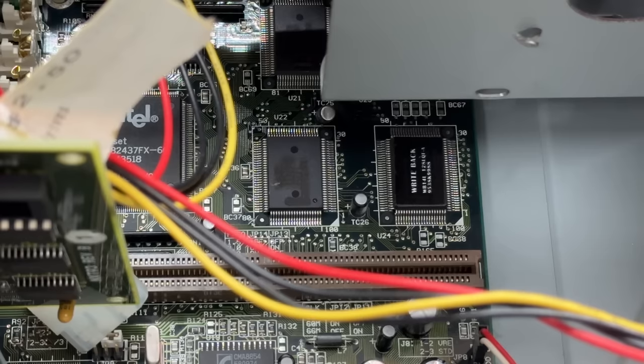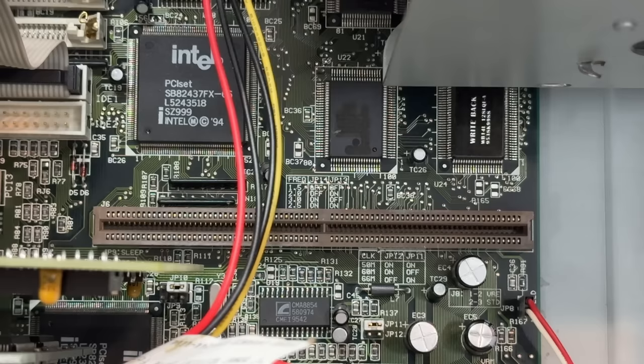I had a system just last week with one of these motherboards in it. They ship these motherboards with these dummy cache chips on them — they don't actually do anything. They don't even have traces running to most of the pins, so you can't just solder on real cache chips either. It's very strange. And we don't even have a cache-on-a-stick module to compensate for it either. I feel like this system was probably built down to a price, or at least upgraded on a shoestring budget.